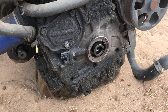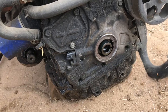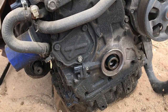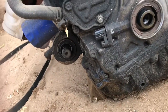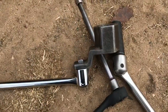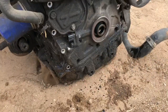Got the crank pulley off. It's going to need a lot of pressure — you might want to use your jack stand bar to add extra pressure, because taking it off was a little harder than I thought, especially when they're stock and they've never been taken apart before. From the factory they are a little hard. You might want to use some PB Blaster or WD-40 to loosen those threads. But like I said, it works every time — these two tools are perfect to take the crank pulley off. So I got all my bolts off and everything.